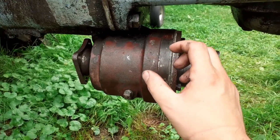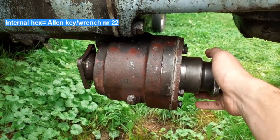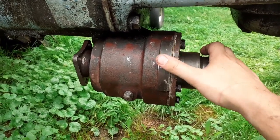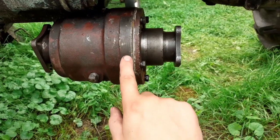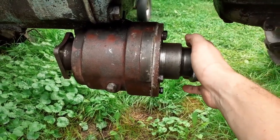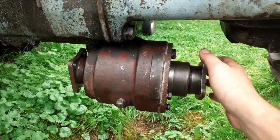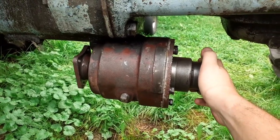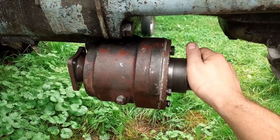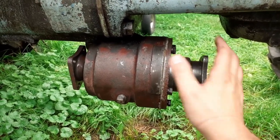The main issue is the tight-tolerance bearings don't come apart easily. If you're going to dismantle it, use a hydraulic press. And if you want to buy one, don't buy the Chinese ones — as you can see where I hit it with a hammer, the casting is chipping. I waited about two weeks for the parts. If you have an OEM one, try to salvage it — don't buy the cheap replacement.